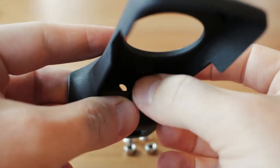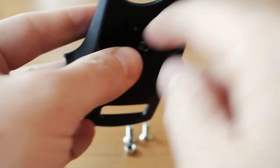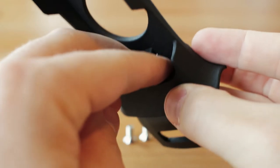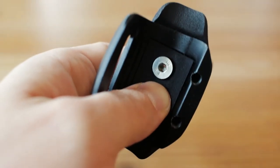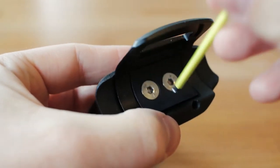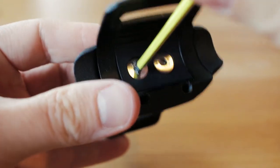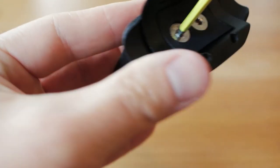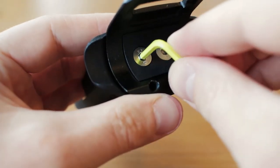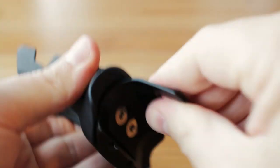Next up you're going to insert the two M5 nuts that come with the kit, and you're going to insert them right here in their little trays. Now we have the M5 nuts inserted. You're going to get your bolts — there's one — and place that in its appropriate hole, then tighten them. They're going to be finger tight, back and forth, until they're both pretty snug. Then take the perpendicular part of the hex key and give it a little twist for a bit of extra tension. That's plenty to have this extremely secure to this front mount part of the BMC cockpit.